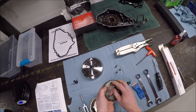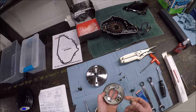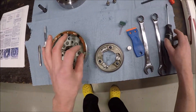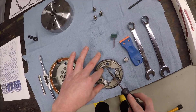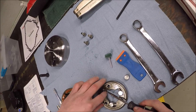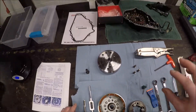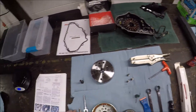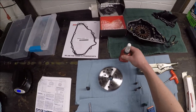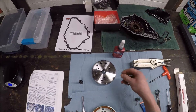I need to transfer the starter clutch. One of the spring-loaded metal pieces will fall out — there's a spring and a little pusher behind it. To get it back in I've just been using a screwdriver to position it. These bolts need to be torqued to 25 foot-pounds, though I'm going to back off a couple foot-pounds since the manual also says to use removable thread locker.